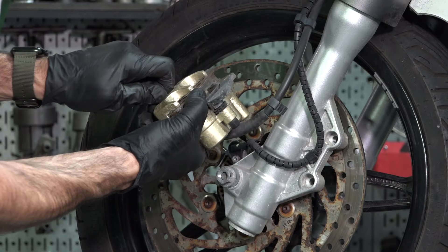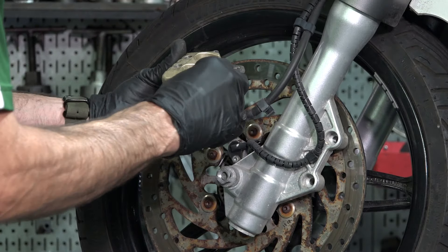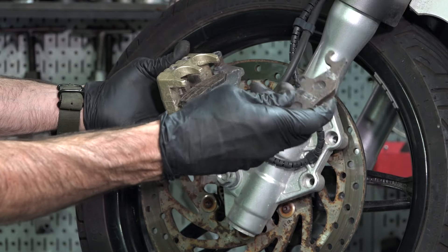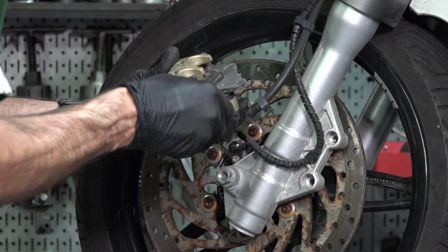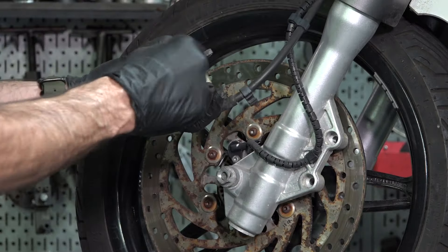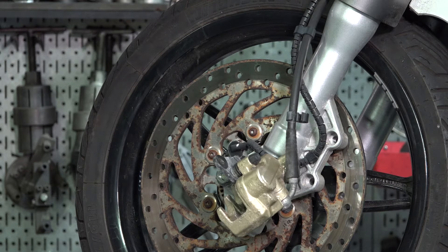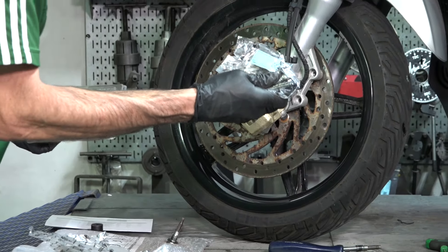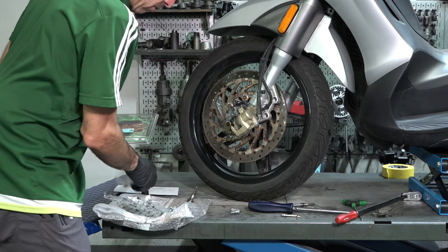Go ahead and pull the pin out. If you push down on the pads, it makes it a little easier. Pull those pins out and we'll take the outer pad out first — it still has some material. These ABS-equipped bikes use a semi-metallic pad versus the organic pads found on the non-ABS brake bike, so they actually bite a little bit harder. And I can tell you the BV350 can use all the braking it can. If you're looking for the original equipment part, you'll find it on the ScooterWest web store — it would be BP250abs-PA, and that's the original equipment brake pads, identical to what I pulled out.